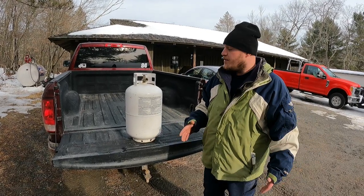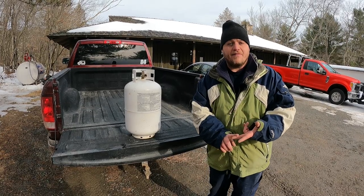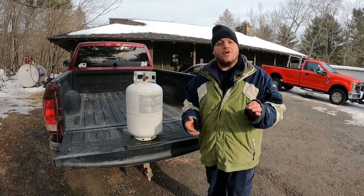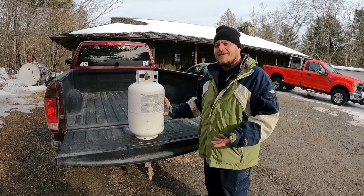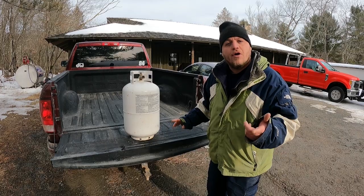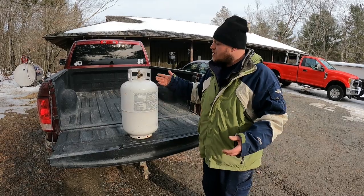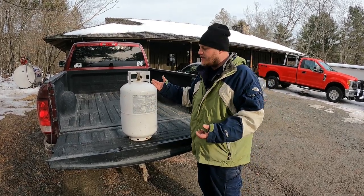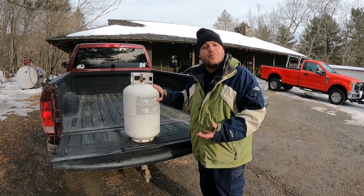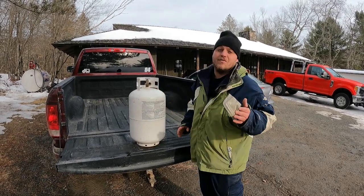The first thing you can do is switch to a bigger propane tank. A lot of teardrops have five or eleven pound tanks; mine came with a 20 pound tank, but I'll go to a 30 pound tank for a cold weather trip. It's not because I'm going to burn that much propane — I won't use anywhere near the capacity. But a larger tank has a larger reservoir of gas at the top, so while your furnace or large appliance is cycling, it gives more time for the liquid to rebound and the tank to pressurize.